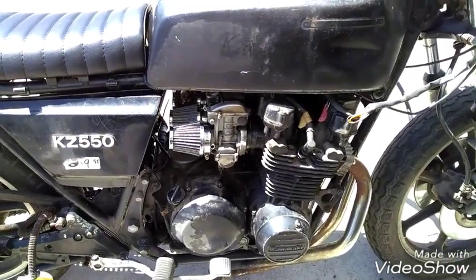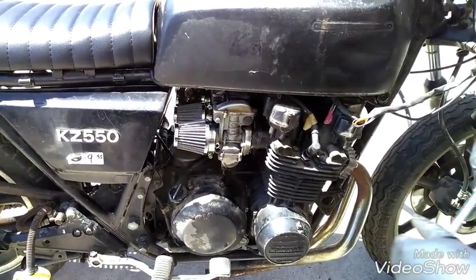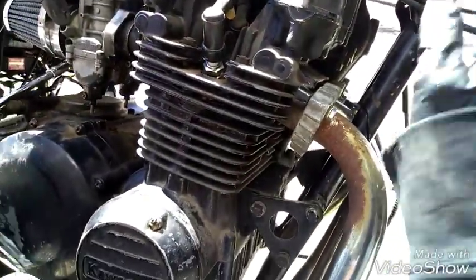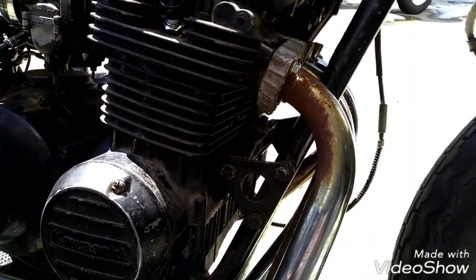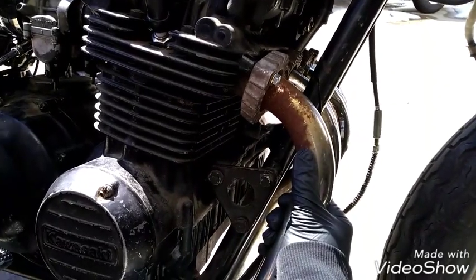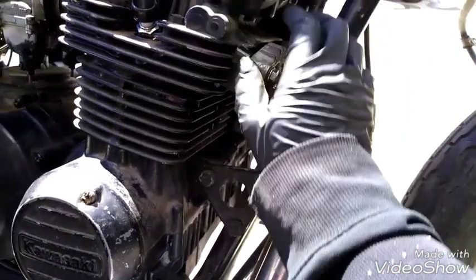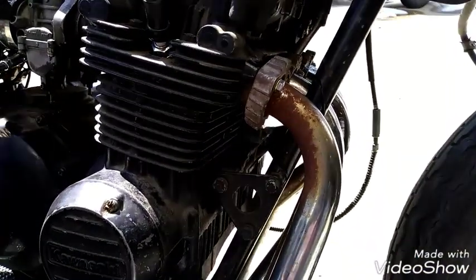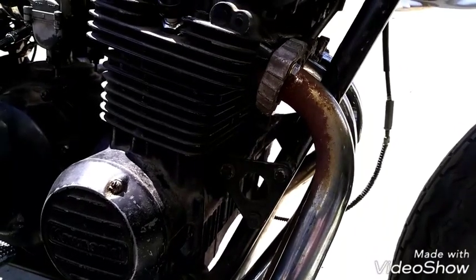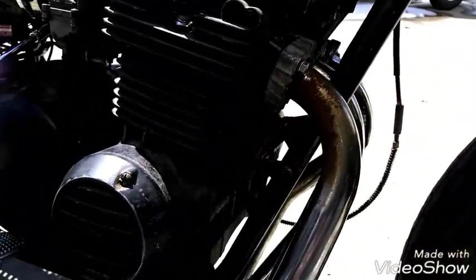Right now we're tying down the pod filters so they're ready to go and don't fly off when we rev it up. We're going to start with cylinder number 4 because that's the one that's not firing correctly — it was warm when I could hold it, but the other one burned my hand a bit. Shoutout to Marcus P, whose channel is called Cafe Life — he watched our video and was actually able to tell that cylinder 4 was off just by the sound of it. That guy must be a badass at tuning. Thanks for the tip.